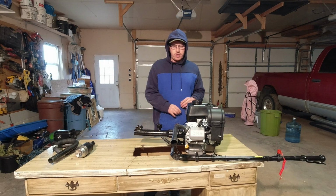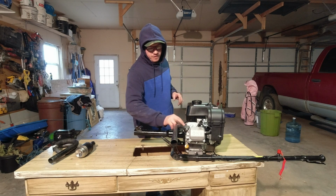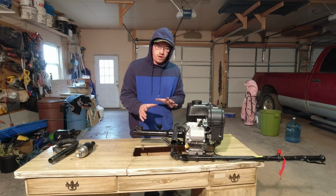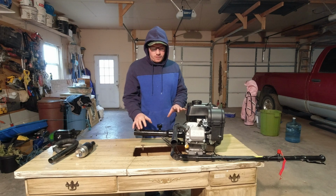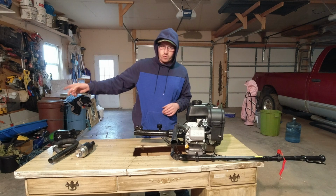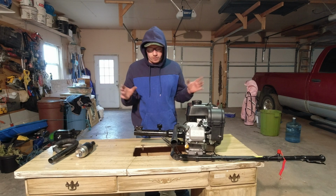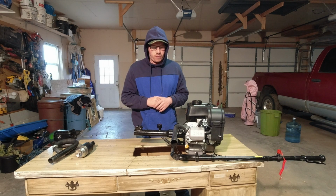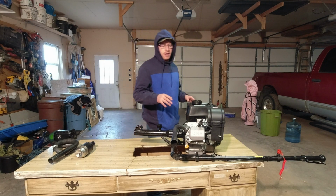So next, guys, we're going to try out the header pipe that's kind of a straight pipe but goes off. This is more for a go-kart. I learned the hard way out on the river that it's not really right for me. If you're out on the river with these mud motors, you want the exhaust to go pointing backwards behind you. But for a go-kart, mini bike, they work great for certain people. But I've also noticed that I wasn't getting the torque that I wanted. But nonetheless, let's show you the sound and how loud it is.